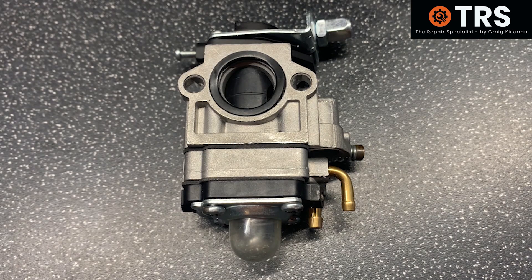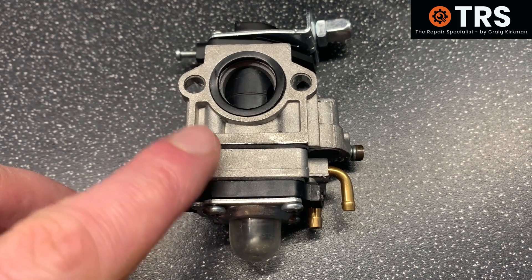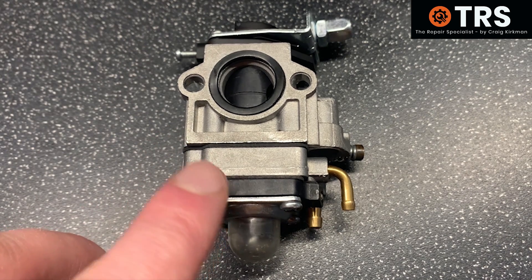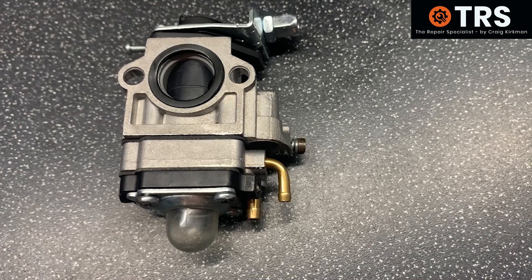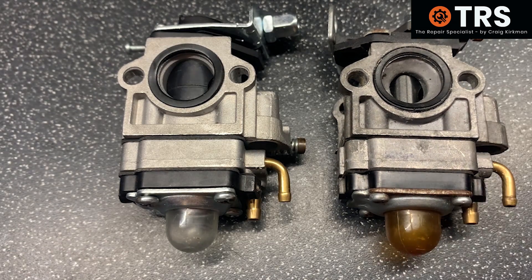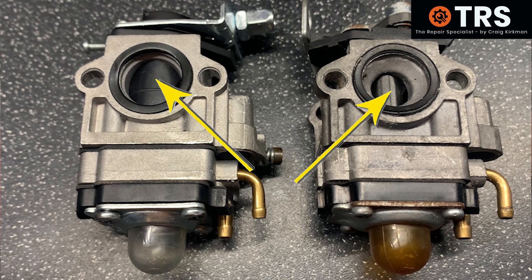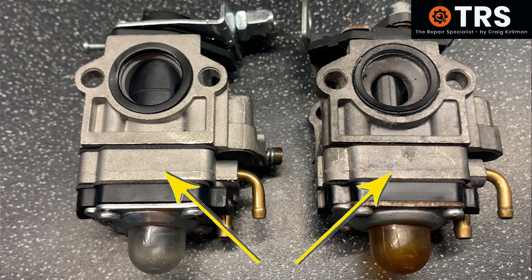Just as a quick, very basic example — there's a variety of machinery that this same carburettor can power, and those different types of machinery may well expect different levels of fuelling from this carburettor. As well as that, similar types of this carburettor mean that even though the diaphragms within them are the same as each other, we can see differences in the size of the venturi or the induction tube — this one will intake more air. That goes to show the variability of these carburettors in terms of what they actually power.